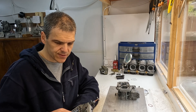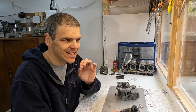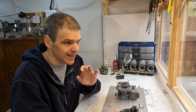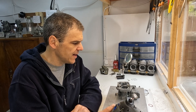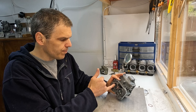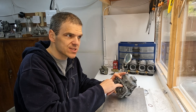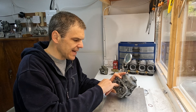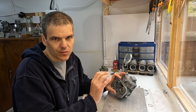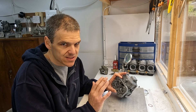It's very simple. I got myself a Dremel and, with a silken glove - really gently without applying a lot of force - I polished the top of here and only the top. Because remember, as you went through the bore, it was 32mm and it was okay. It's just the top of the bore that needed minimal, minimal kind of grinding. This took me like 10 minutes.